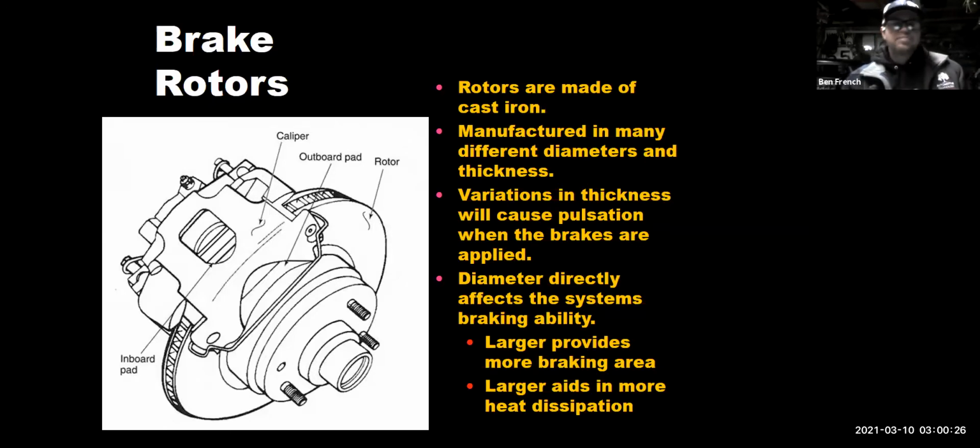But anyways, most brake rotors are made out of cast iron, and it's heavy, but it's a good friction surface material. Why would you have carbon rotors and all this crazy stuff? Carbon fiber is very light, and vehicles that have stuff like that have to run very high tech, special brake pads that are compatible with those rotors and everything else. All right.